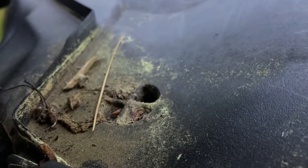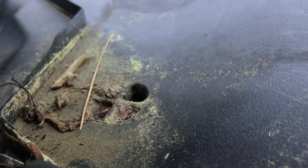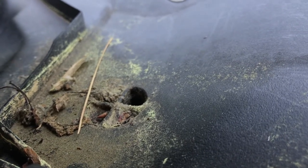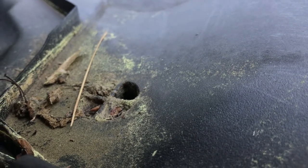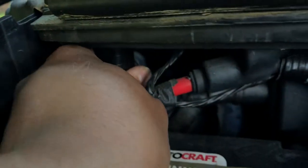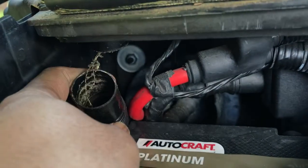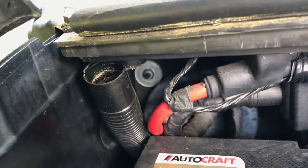You can see it's kind of got the little plastic four-way split — that's Land Rover's attempt at filtering out any contaminants. Any giant particles should get caught, but pollen and dirt builds up over time, they get blocked, and then you have water pouring over into your battery compartment. Good thing to check those out. To disconnect the hose, all you do is pull it straight down and out. Look at that garbage we got in there. Alright, that's all for today.